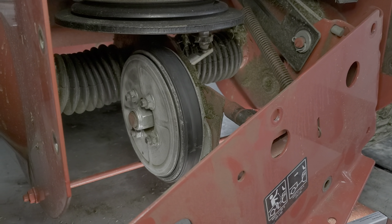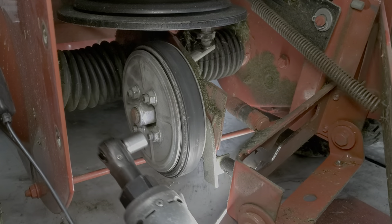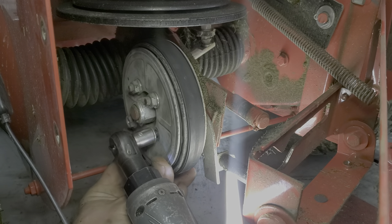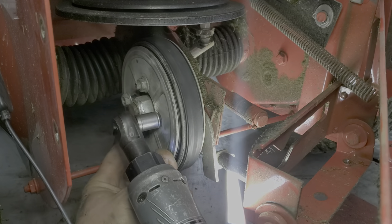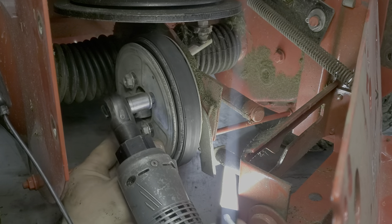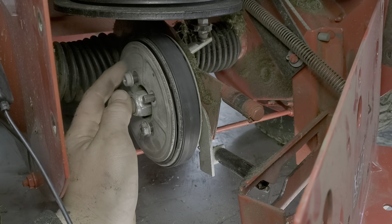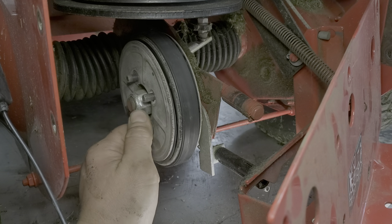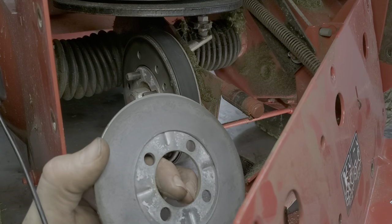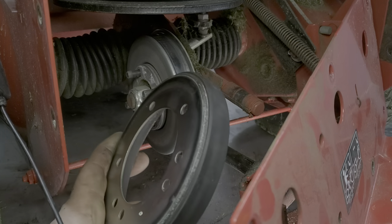All you're going to need is a half-inch. Getting down through the bottom is nice and easy most times. All you're going to do is take off these four half-inch nuts all the way around — this should all spin freely as long as you've got it in neutral. Once you take those off, everything's just going to fall out. Pull your plate off and you've got your friction disc there.